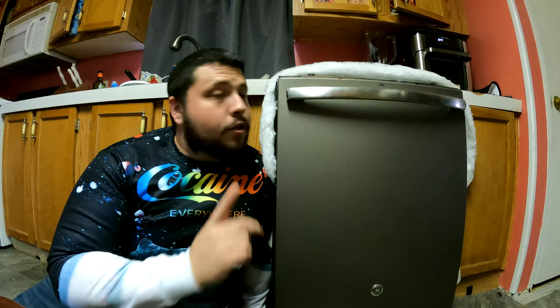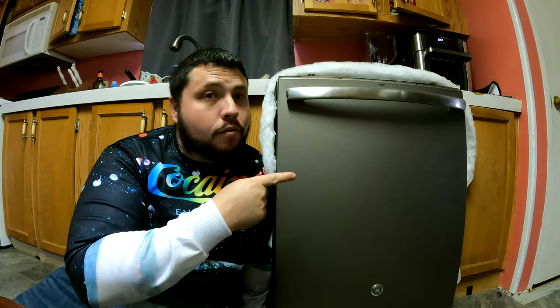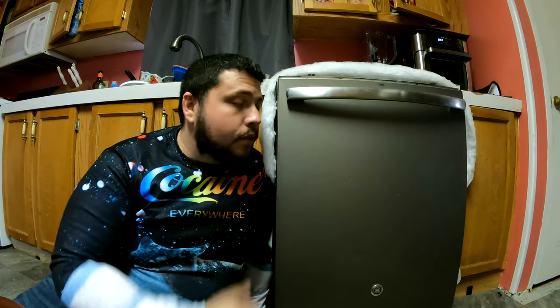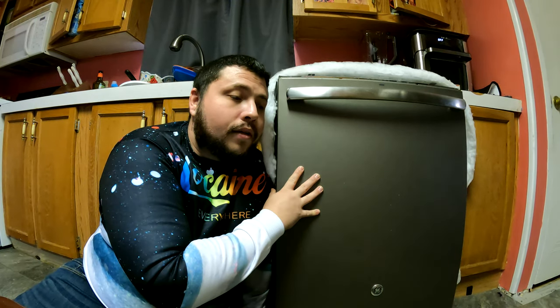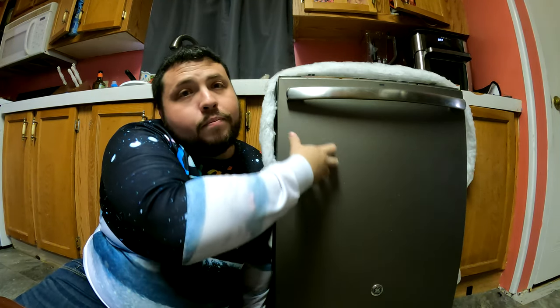Anyway, so if you want to replace your water inlet valve, first thing you need to do is cut the power off to your dishwasher through your panel, which we go over in my other videos. Then you're going to want to start taking this guy out. If you don't know how to take this dishwasher out, you might want to consult a professional. Or if you feel like you can have it covered, take your power out, unscrew the two screws up top, start pulling it out. Just be careful of your flooring.